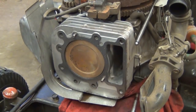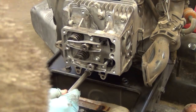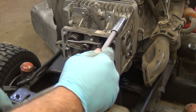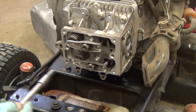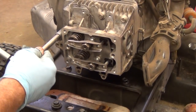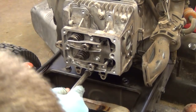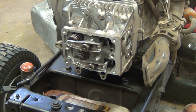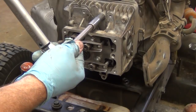I've checked the cylinder head for flatness, cleaned it up, and both valves are working okay. I put the cylinder head with both push rods back in as one assembly — I've done this so many times I can set it up without removing the rocker arms. If it's your first time, you'll probably need to take those rockers off and reset the lash. It's really important to have the proper valve lash, or your compression release won't work. I can't tell you how many guys I've seen replacing starters, batteries, relays, and cables only to find the starter won't turn the engine because the valve lash is too loose.